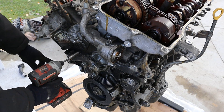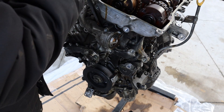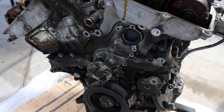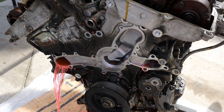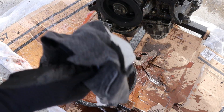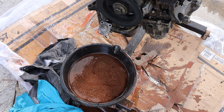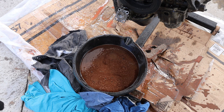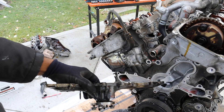There are a bunch of 10s and 12s running all the way around this water pump, so I'm going to remove those — you really have to keep track of which one goes where. Removing the water pump thermostat housing exposes more water pump bolts up here. That made a huge mess — I'm using old clothes to clean it up. That water pump was really on its way out. It's a very common problem on these 2GR engines, compounded by the fact that it's really hard to access in the car.